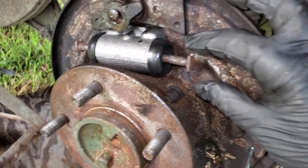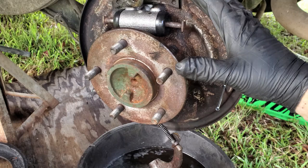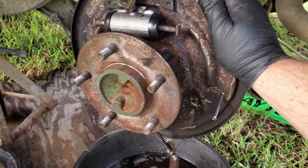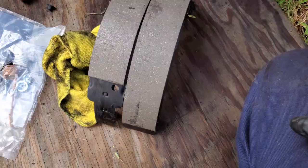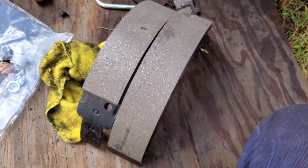Got our wheel cylinder in there, cleaned up our little push bars - I'm not really sure what to call them - got them all clean and stuck in there. Now the fun kind of begins. With drum brakes you kind of got to put it all in at once and hold it while you're trying to clip all the springs together, and it is a bit of a nightmare. Here's a very important thing to pay attention to - you see those are different. The big ones always go on back. Remember: big on back. That's the easiest way to remember it. Big shoes back here, little shoes up here. The shoes themselves are the same size actually, but the lining is different sizes, so pay attention to that - I had to learn the hard way.